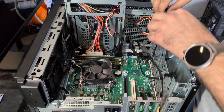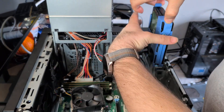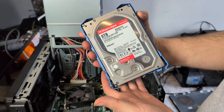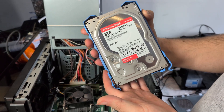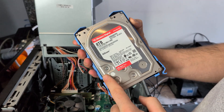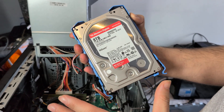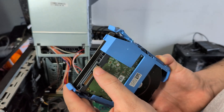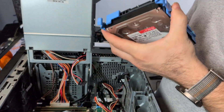So what I started with for data storage — I wanted to go with something small, but I couldn't get anything smaller or cheaper than this. Some of you might say you should have shucked a Western Digital drive and used that, but the current prices for drives are crazy. This drive costs only 10 bucks less than a shucked drive, and I don't need to spend any time tracking it down or fixing the 3.3-volt pin on the power header so that it works straight out of the box. So that will be our storage.